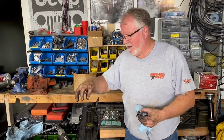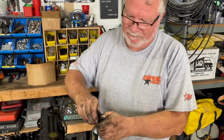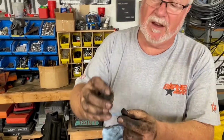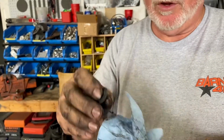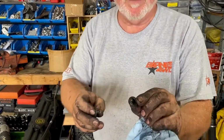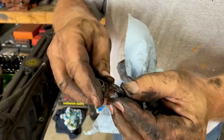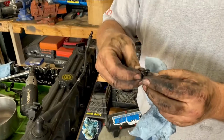Now when you take the valve cover off, what you're going to see is what look like washers I was mentioning earlier. And I've popped one out, and what they actually are, although these are a little crusty musty, is they're little washers all right, except that they have a stem. And then there are little old rubber donuts in here that go through the holes, and then the washer goes through them and then through the valve cover.